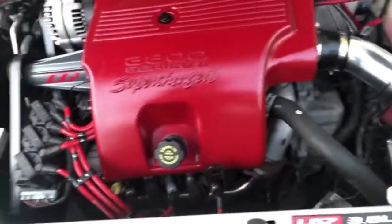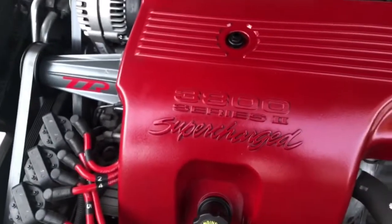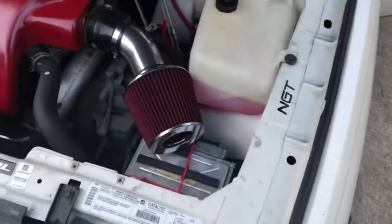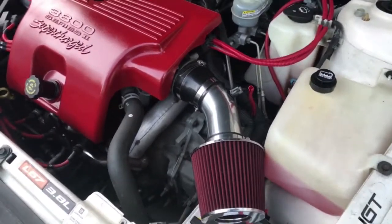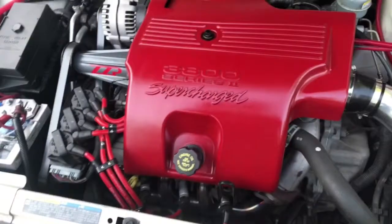I do hopefully want to switch to E85, and also probably get this thing intercooled. If not intercooled, I'll probably do water-meth injection, which kind of scares me a little bit because for real performance you'd have to run like a 75/25 ratio, and that's where stuff gets sketchy.